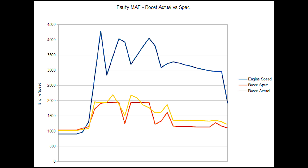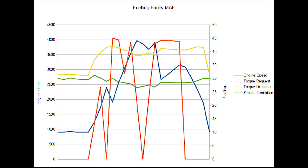I wanted to do a sense check to make sure I didn't have a boost leak. I had a look at a couple of things — I thought I had a split in the pipe so I replaced it, but it was just wearing out. I also thought I had a tiny leak but it must have been ever so slight as it didn't affect things. You can see on this graph that the boost specified and the boost you're seeing are more or less the same — in fact the car's probably producing a bit more boost than it should.